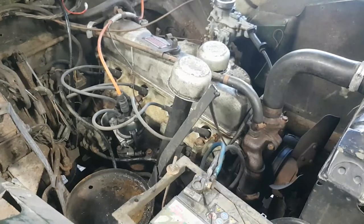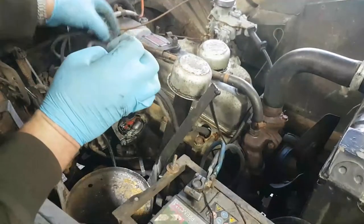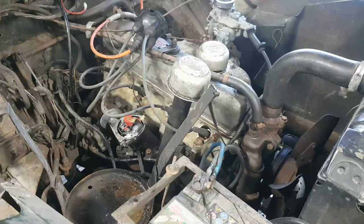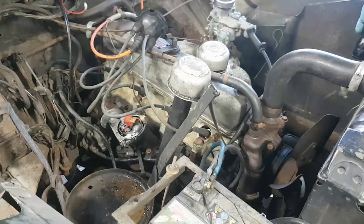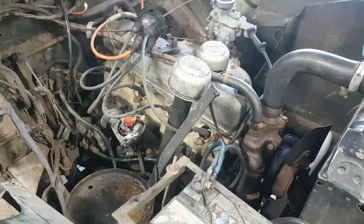Right — this will be ignition timing because I've adjusted it, so let's get top dead center by cranking the engine over. Number one's up here, so we're coming up toward the number one firing position. Not far off the timing point on the engine. There it is — that'll be top dead center. Right down here you can see the three teeth. The nose of the torch is almost on them — three teeth and a big tooth — and I've got it marked up. You can see the line on the crankshaft pulley.